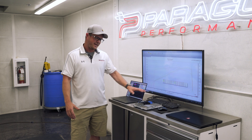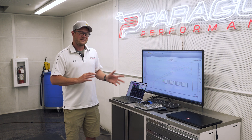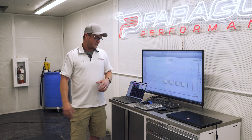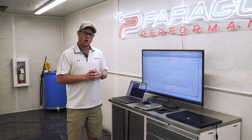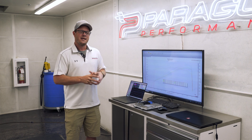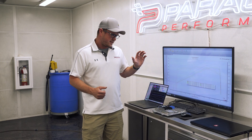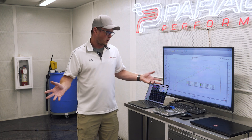By now everyone's probably seen the cost to get started on tuning. The ECM unlock is $1,500, and the credits to tune the ECM are $400 — a one-time fee to tune the car as much as you want. But that isn't a small amount of money just to get started, and it doesn't include custom tuning, dyno use, or anything else. So a lot of folks are going to ask: is it worth it to tune my C8 right now, even with bolt-ons, just for pump gas? That's up to you. We can optimize a lot of things — make the car run with less knock — and if you're using the car on track, that's pretty advisable. If it's just a weekend cruiser, it might make sense to wait until you're ready to add boost or a cam. But if you have access to E85, in my opinion this is definitely worth it for the big jump in power, much better knock resistance, better track behavior, and more performance with just a different fuel type.